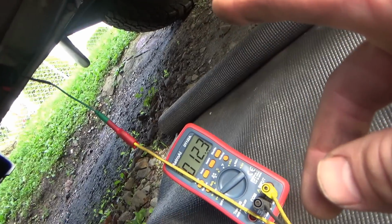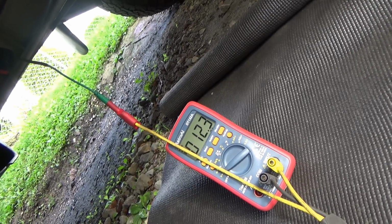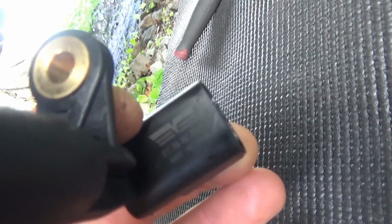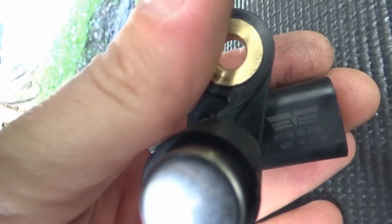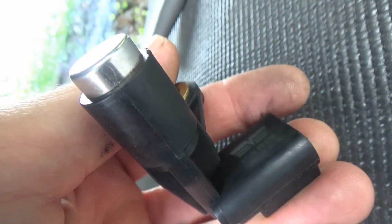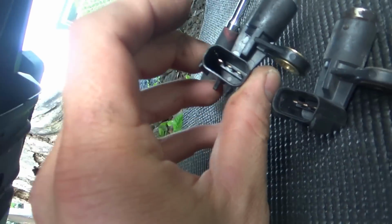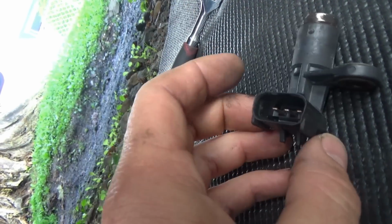So I'm going to take out that crankshaft position sensor and try to reinstall the original one, see what happens. Alright, so got the old sensor out, only took a minute. What do we see? We see the flying wings. That's your money flying away, because Dorman does not build anything good that's electrical. They build door handles, diff covers, fuel lines maybe, but not electronic components. So I'm going to try to reinstall the original crank sensor. Now this may be bad, but at least we have a fighting chance here compared to this junk. If this doesn't work, we'll have to get an OEM replacement.